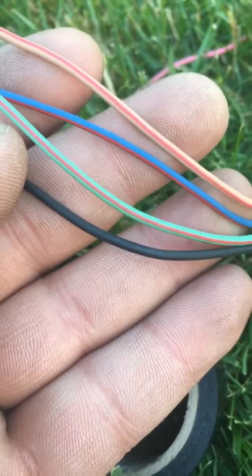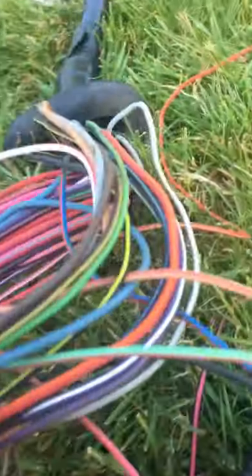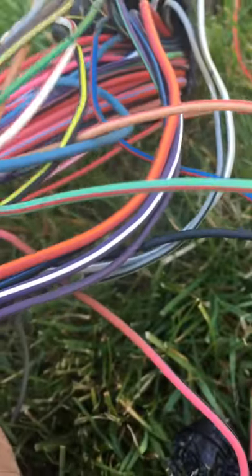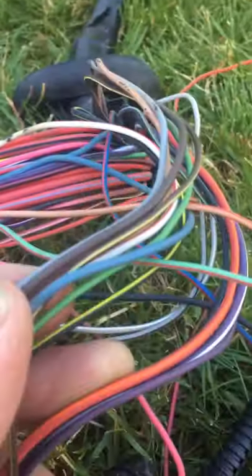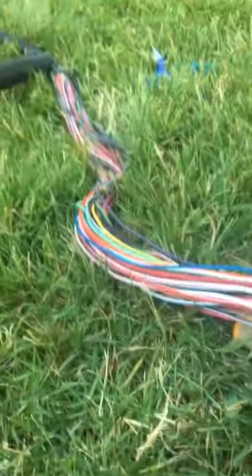These are the four primary wires to the servo plug. Now this is the initial conundrum — you're going to cross the rest of the wiring harness through multiple points. The dark blue, or blue with red, goes into the cab, and the other three carry on across the harness at different points. Unfortunately there's no way to pull that plug through by itself, so you come to a decision: am I going to unravel it all the way to follow these wires through?